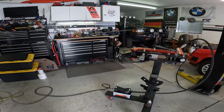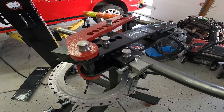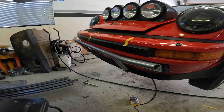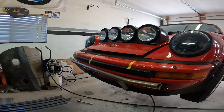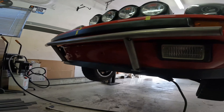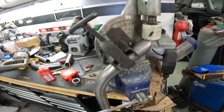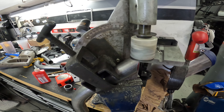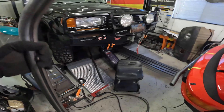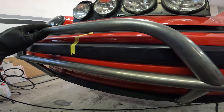For the first time around it wasn't too bad — I didn't flub anything up too much. So we got the tube on and I made some brackets that tie in underneath to the frame. I think I'm going to build a little crossbar, just a loop around the top, and then of course the skid plate is going to go right in the middle there. We just bent up the top hoop and I'm doing some notching. There is a nice notch — let's see how this bad boy meets up. Oh yeah, looking slick!